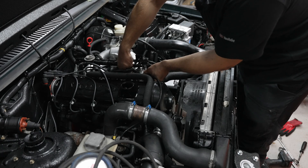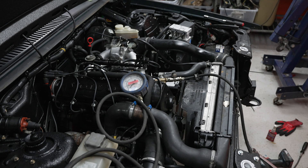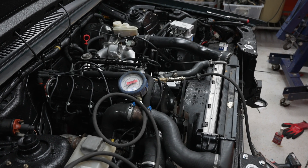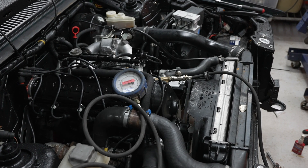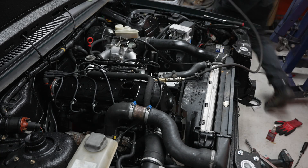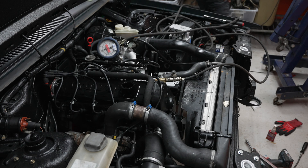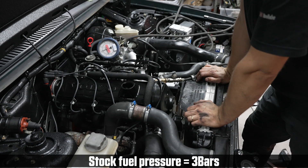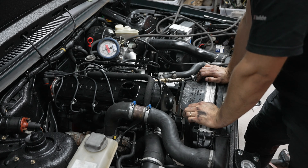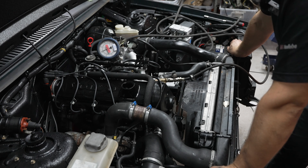So let's check out the fuel pressure now — it's like a tire valve going on here. I'm going to cycle the ignition and let's see what we get. I got 3.4 bars — that's actually a little bit more than we should have. Fuel pressure is slightly high. I have run this car with this pressure regulator and I haven't had any issues, but that is definitely something worth noting — it is producing a little bit of overpressure and should probably be replaced. Anyway, we got fuel pressure, it's not leaking. We have oil pressure, that's not leaking.